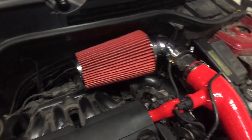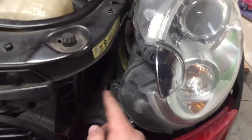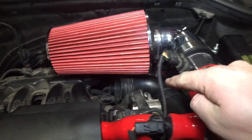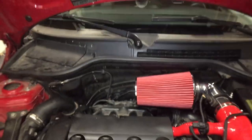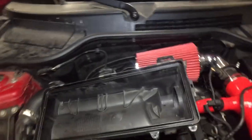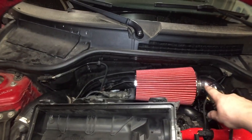Well, what I want to do actually is, because on minis, for those that don't know, cold air gets sucked in through here, goes through this pipe, and goes through here under there, and blows cold air right here. So everything's here. This usually sits under there, it sucks up the air through here and it kind of keeps this area cold. Well, this doesn't fit with this.